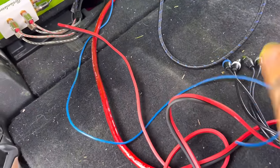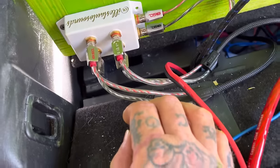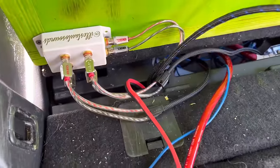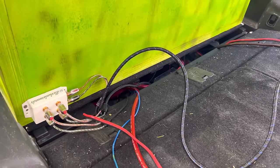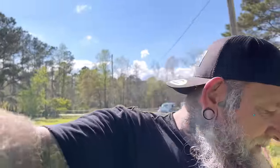I've got the remote here that's live, the speaker wires, the ground wire, the positive. Here's where I put the old amp — I bought it on eBay. It works though. Mount an amp right here. I know people say don't mount your amp to the bottom, but that enclosure is double-layered everywhere — it's good. I have nowhere else in here to mount an amp anyway. I do have a four-channel that was in the old Edge. We did a 40 hertz, negative 5 dB tone to set the gains.